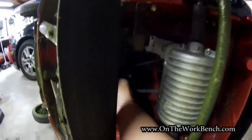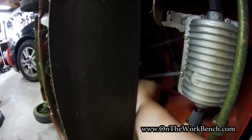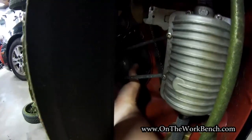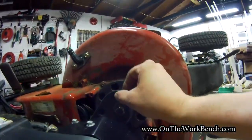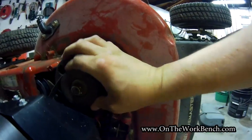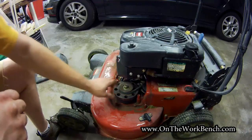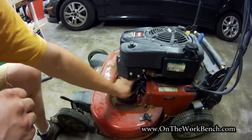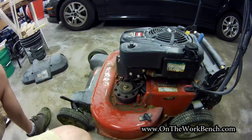To double check belt alignment, come back here — there may be some loose grass to move out of the way. There are two pulleys: the bottom pulley is the transmission and the top pulley is for the blade drive. I'm going to seat the belt on that top pulley closest to the engine. Coming back around with the mower on its side, I just reattach this belt. Now with the belt correctly attached, there's a little bit of slack — not a lot, as this will engage.